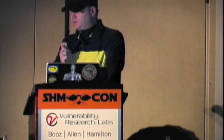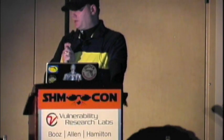There is a way to copy the serial number. What he's asking is he cloned a drive, but he had maybe some software that was dependent upon a serial number on the drive, and that something happened with the software not recognizing or something not recognizing the serial number correctly, or even things like Windows. Sorry? So, yes, there is a way to do it. However, it does require a tool that can talk to the system area. So most of the tools are fairly expensive. There are some low-end tools that I have seen called pokers. So if you do a search for a poker, there are hard drive pokers.